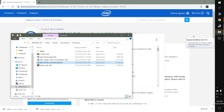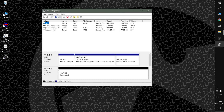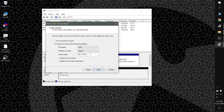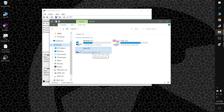Okay, so we're done with the Wi-Fi. Now let's install the solid state drive into the operating system. We'll go to Start and search Disk Manager. Once it's open, we can see that the new 500GB hard drive is right here. Right-click it and go to new simple volume, assign whatever drive letter you want, use NTFS, and name it whatever you want — I'm just going to call it Data. And you can see Windows Explorer opened up, and if I go to This PC, I can see my new 500GB hard drive at volume location E.